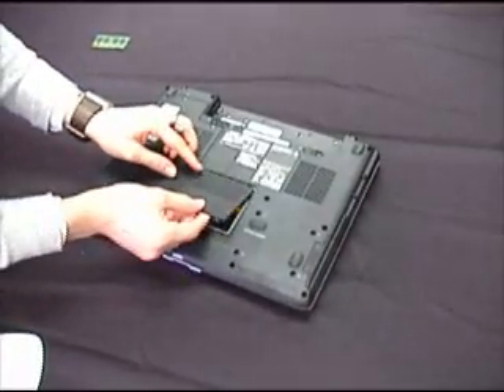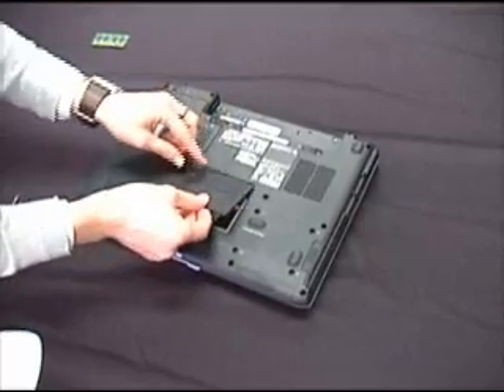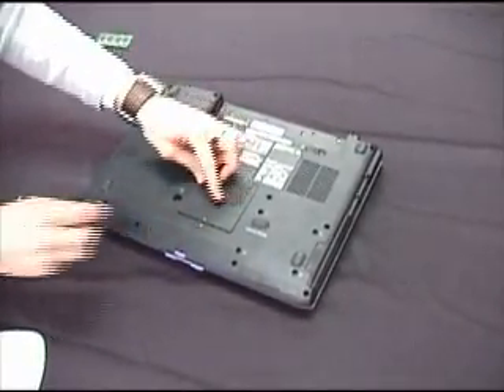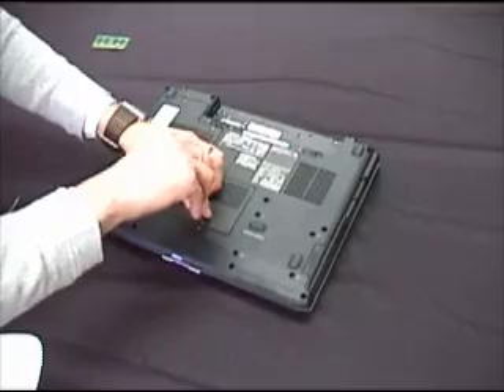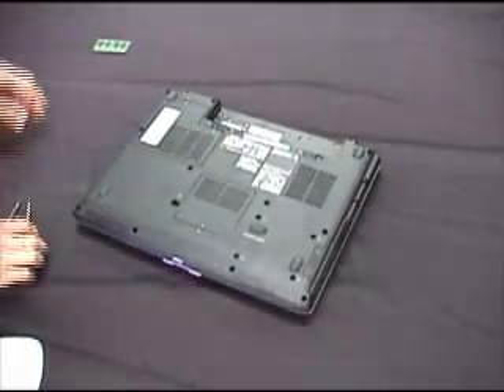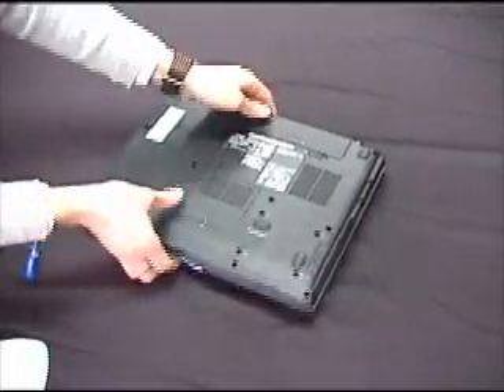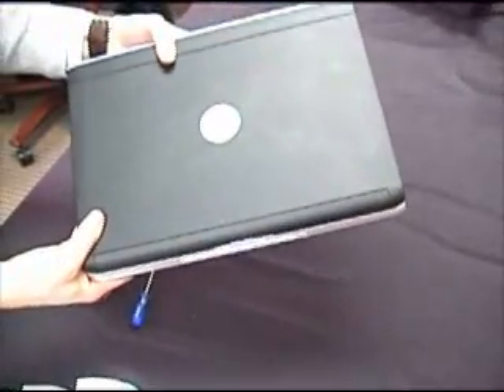Take your compartment again, place it in — two notches at the top slot in — and press it down. Tighten the screw. And that is literally your laptop upgraded. Just put the battery back on. There you have it: a Dell 1520 upgraded with two gigs of RAM.